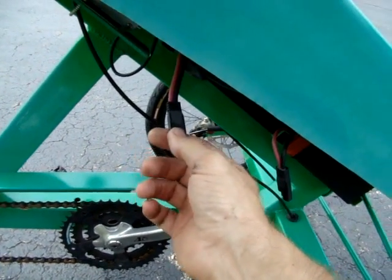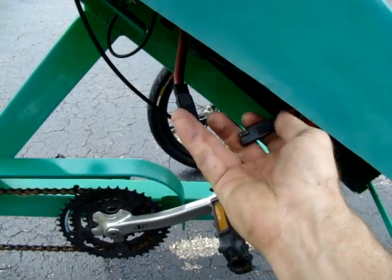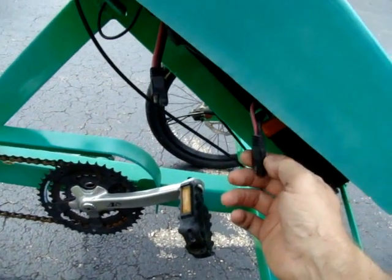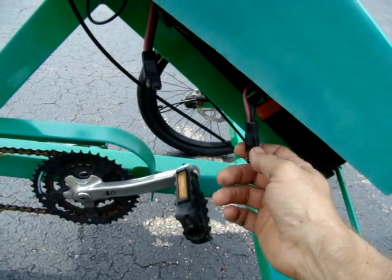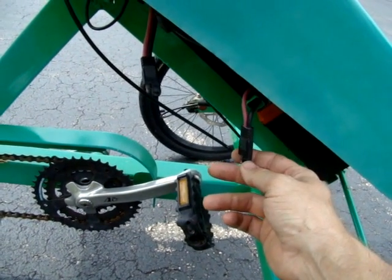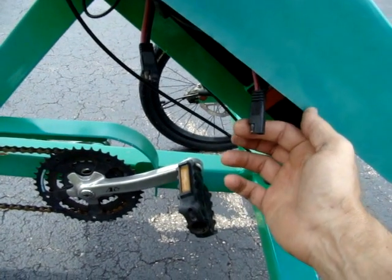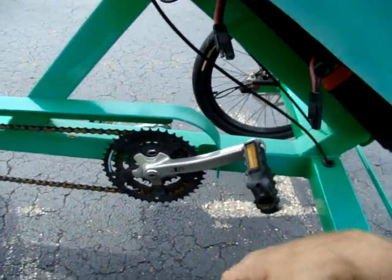These are to charge the batteries. There's 2 batteries in here. Please do not plug those in, because you'll short circuit the batteries together. What you can do is the solar panels will keep this charged really well for the most part. There are situations where if you drive it at night or something, obviously it's not charging, and in which case you can just plug a regular 12-volt battery charger in there.